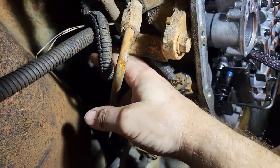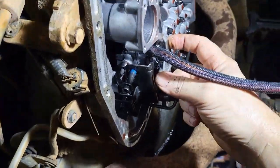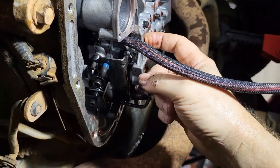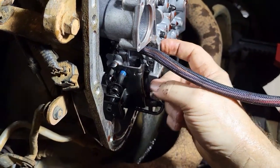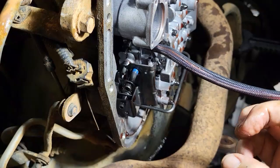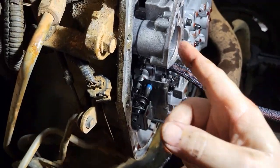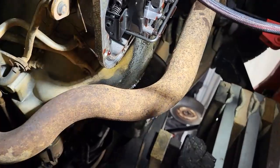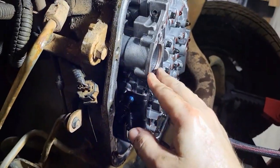Straight above where this is at, all the way up in here on top, there's an electrical connector — you just squeeze it and it pulls off. I got that off. It connects to the other side up there so this should just come off. But there's also this spring — right in this area there's a spring that goes through here and we just need to be really careful that you don't damage that spring. All I have to do now is grab this and work it and pull it off. It's got a couple of O-rings that go through the top side of the transmission — you just work and pull those and pull this right off.